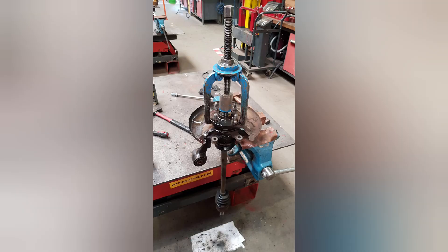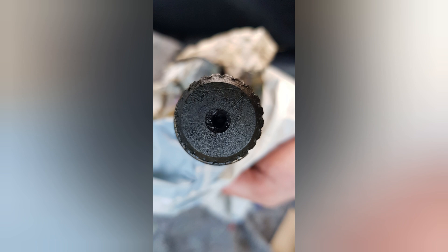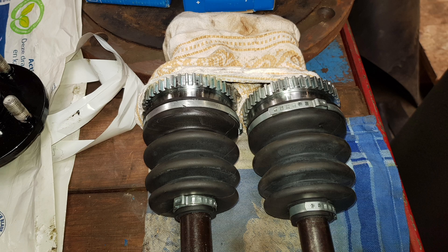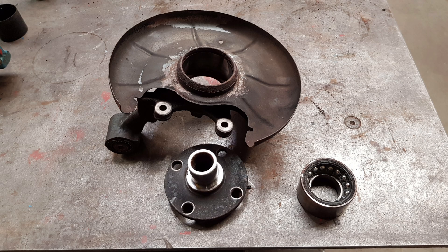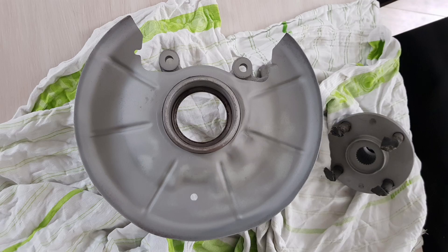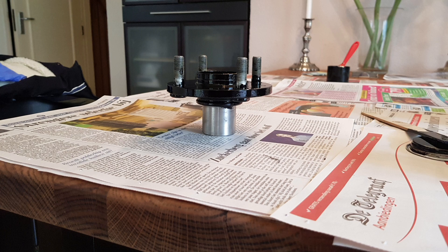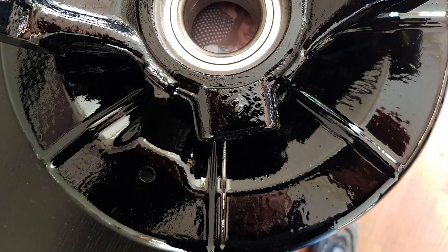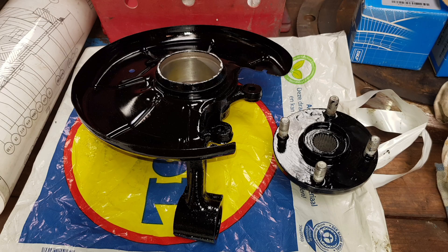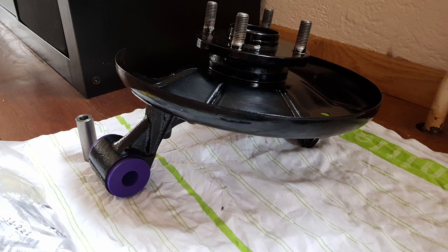Separating the wheel hubs from the half shafts took so much force that the outer joints of the half shafts had to be replaced. So I took the damaged ones off and replaced them with a new pair. Although these had ABS rings and mine didn't have ABS, that was no problem. Then it was time to take on the wheel hubs. After ordering a new pair of wheel bearings I pressed out the old ones and sandblasted the outer surfaces. To put the new bearings in I used an induction heater. I used the same caliper paint kit I had previously used on the brakes, only one for each hub as I put down multiple layers. The end result was two nicely rebuilt wheel hubs which were also complemented with a new polyurethane suspension bush.